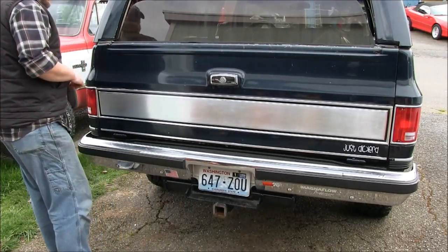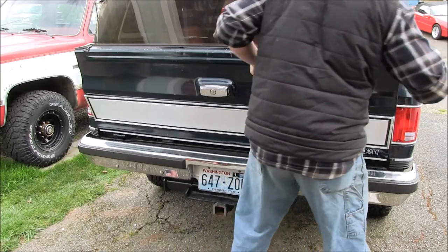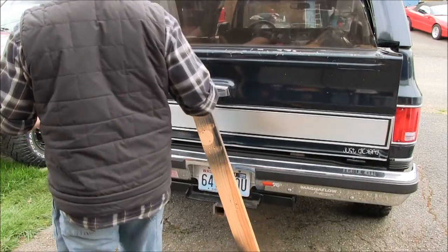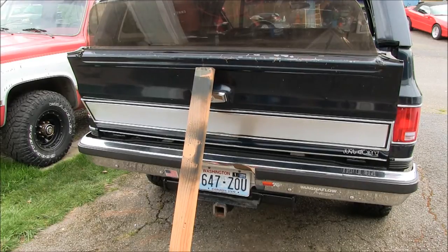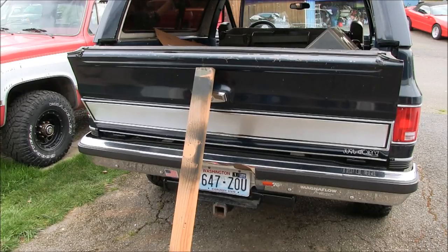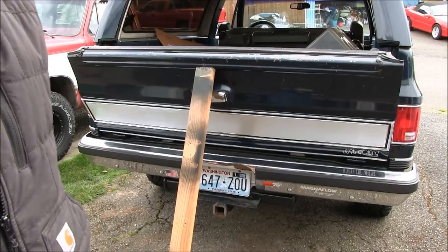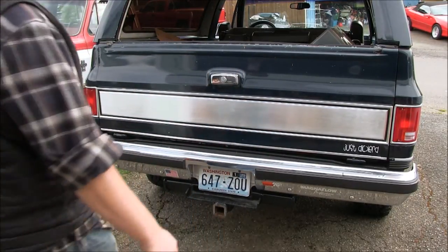Let's put that tailgate window down. Nice to get this switch on the back down so I can do this with the key, but thinking that the motor may have been going bad on this thing, but all the window motors are slow. So I'm wondering if it's just not a ground issue. Something else to look into in the old truck once I get her rolling here.